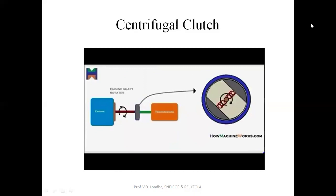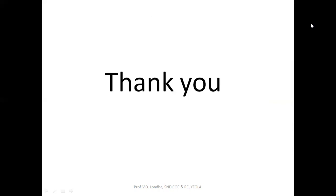Let's see in more detail. The engine is getting the drive. The engine shaft rotates and that drive reaches the shaft inside the centrifugal clutch. As it rotates, the centrifugal clutch shoes and the clutch housing get in contact so that the drive gets to the clutch housing. You can see the clutch housing is now rotating. As the clutch housing rotates and is connected to the transmission shaft — that green shaft, the clutch shaft — it rotates and makes the drive reach the transmission finally. That's how a centrifugal clutch actually works. For more videos, please click the subscribe button. Thank you.